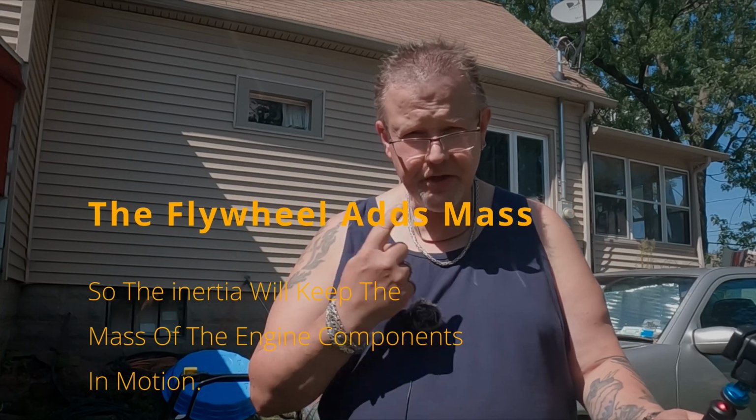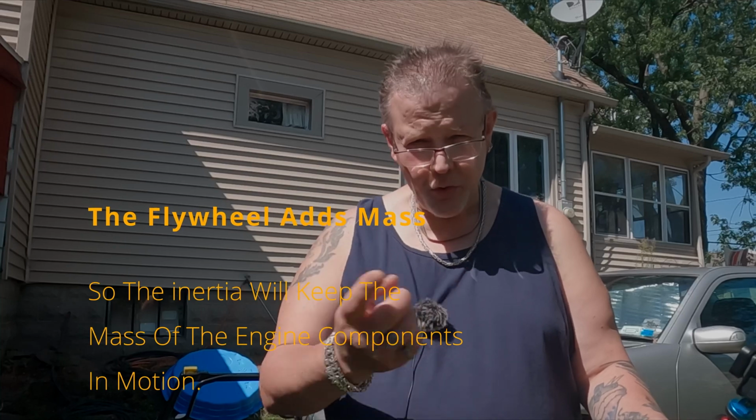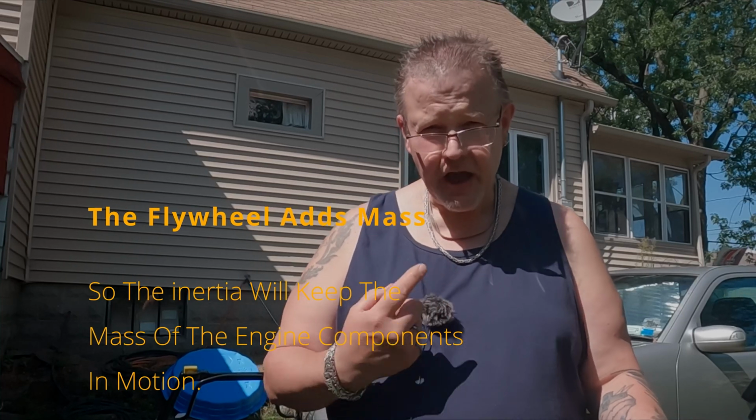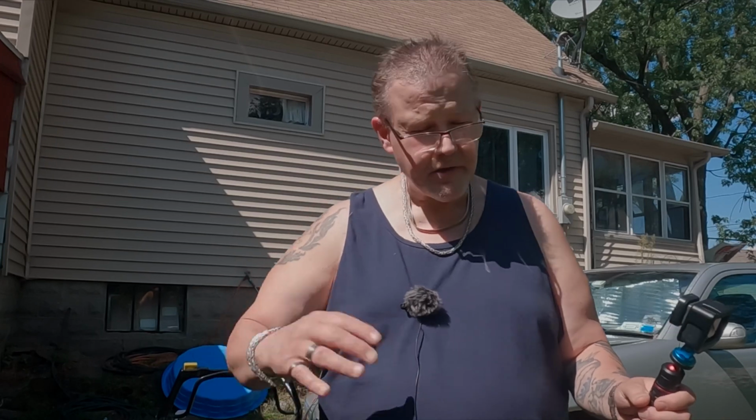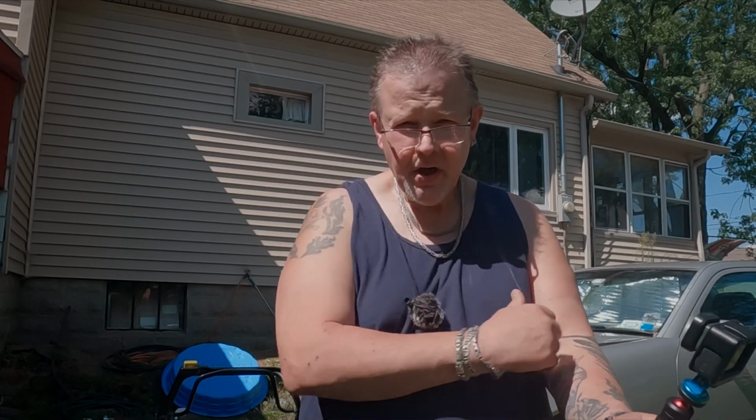The ignition system on these lawnmowers is very, very simple. The flywheel, the part that spins around on the top of the engine, it also cools it. It's a fan and a flywheel. It's weight that keeps the inertia going, so the engine will keep on rotating through the 4 strokes because it's one piston. Usually, even some of the 2 cylinders have a lighter flywheel, but that's something else. So anyway, the ignition system is a magneto. It does not work with, per se, an ignition coil setup like an electronic or a points ignition. A magneto works like this.